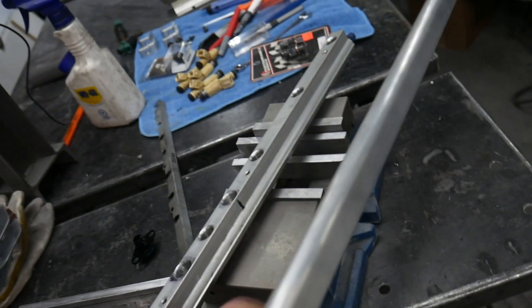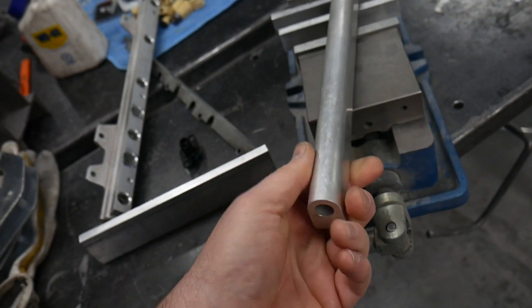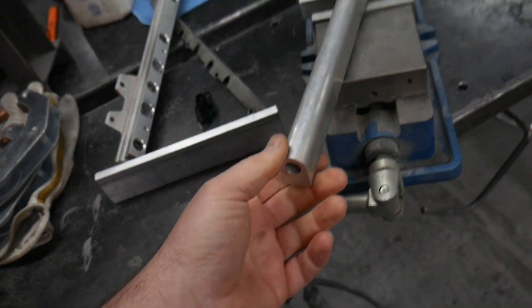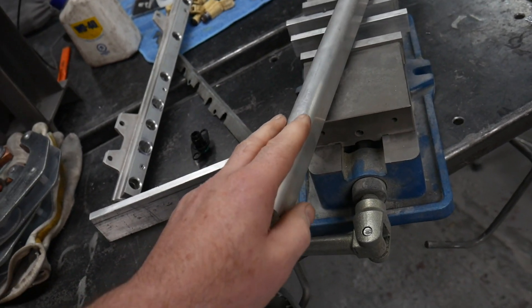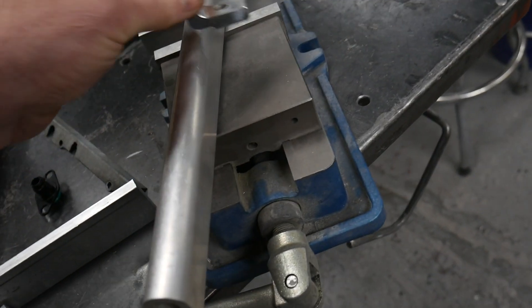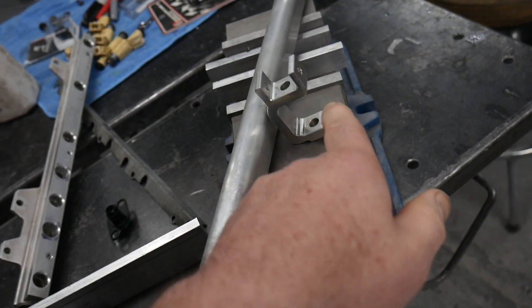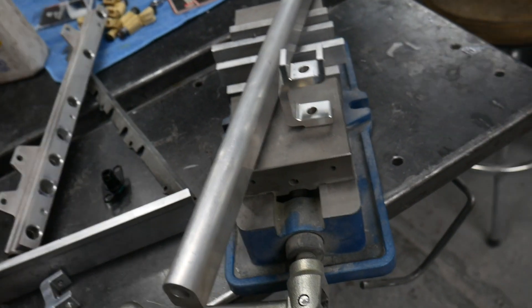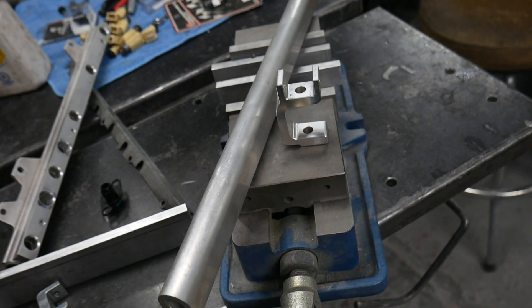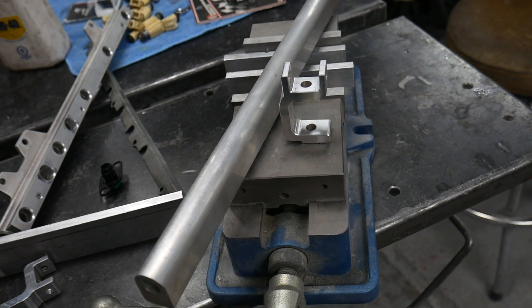Sitting in the back corner all along, I have fuel rail material — this is standard race AN6 stuff. I have the tap and I have the drill. So now we'll just take that small disaster and turn it into an opportunity — we'll build the fuel rail. The only hard part is I lose the connection points. But many years ago I bought the CNC machined brackets that go with the fuel rail. The mount foot is pointing the wrong way, so I'm going to have to cut them, turn it around the other way and weld it back on. I mean, I don't actually try to make drama — drama just happens in the garage.